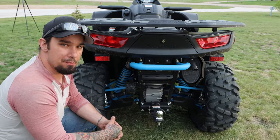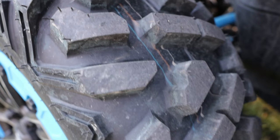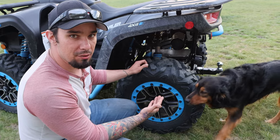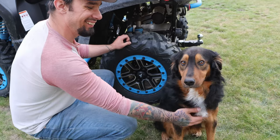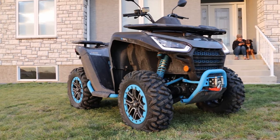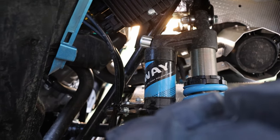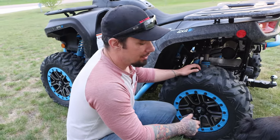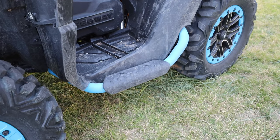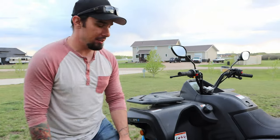There are all sorts of reflectors and lights around the corners. The tire package is the same across the Fugleman, Snarler, and Villain — a Wanda tire, which is a very light, soft tire perfect for the average trail rider or hunter. The deluxe version comes with beadlock rims; the base model has steel or base aluminum rims. The suspension has piggyback shocks — you can adjust preload and have three stiffness settings via a dial on top. There's also a side protection bar that will protect your plastics if you rub a tree.